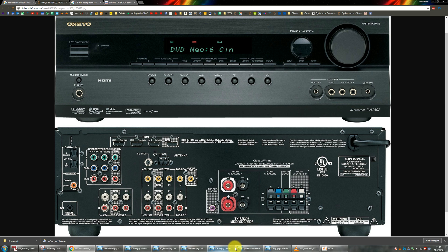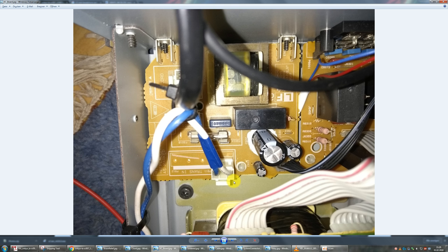So I opened it up. Inside the Onkyo amplifier you will see there is an AC input board in one of the corners — AC from the wall comes in straight here. Then there is an auxiliary transformer that creates a very low-power 12-volt rail. And then there is this relay. Once you hit the standby button on the front or push the power button on the remote control, it will actually engage this relay, which will then turn on the main transformer and the main amplifier. Fortunately, this relay is also 12 volts, so this is why I plan to use it.